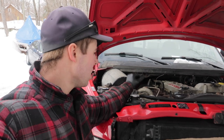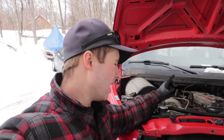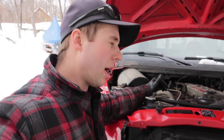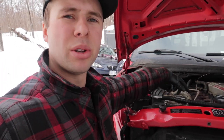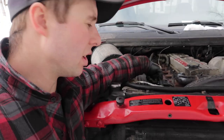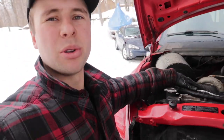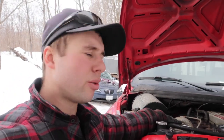Alright guys, so thanks for watching. That's just a quick tutorial on how to troubleshoot your 47RE, and hopefully this fixes it for you because it costs you next to nothing — all you're buying is tinfoil tape to shield that wire. Basically just pull it out of that wire loom, reroute it away from your alternator. I just coated it in about two or three layers of tinfoil tape and it stopped my transmission from gear hunting.